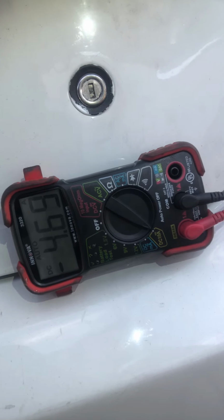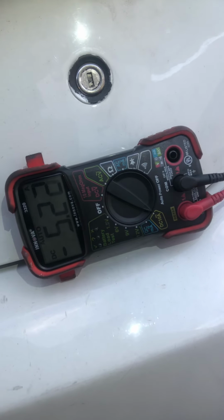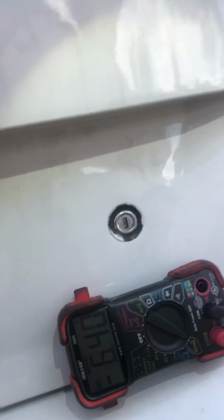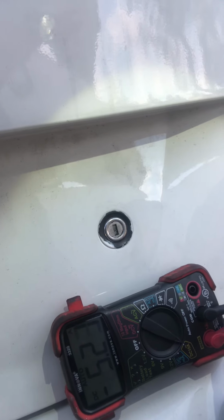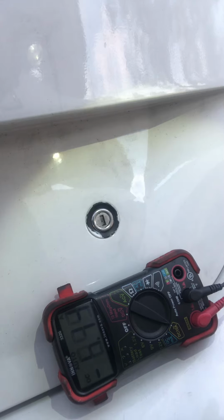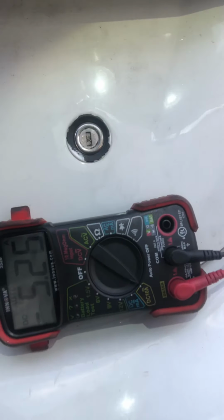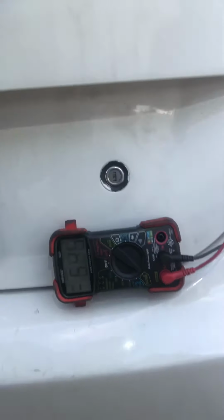So for an issue like this, you guys would be dealing with the fuse box, pulling fuses to determine what will be our source of this draw. Pretty much what I've done is inline on the negative cable. I've hooked up the black lead to the chassis ground, and the red lead is hooked up to the battery terminal without losing our connection to ground at all when I separate the battery terminal. And then have your little meter set on amps. Obviously move the plugs over and then set it up like that.